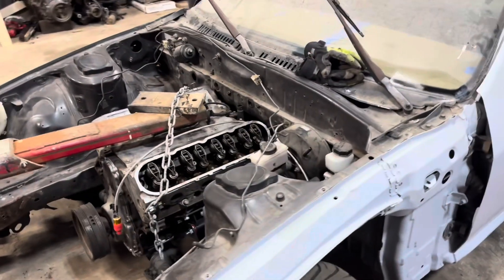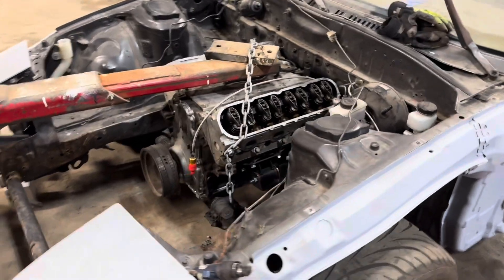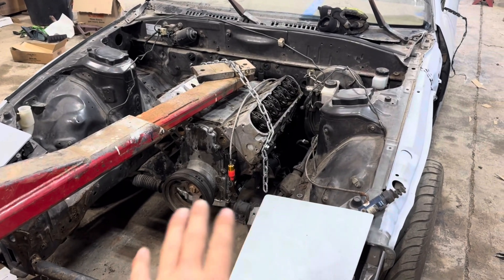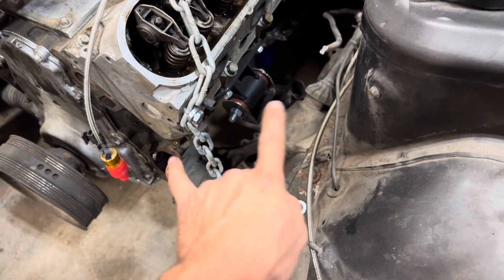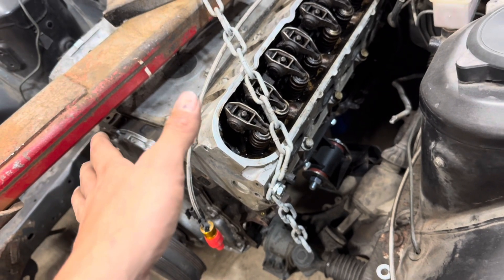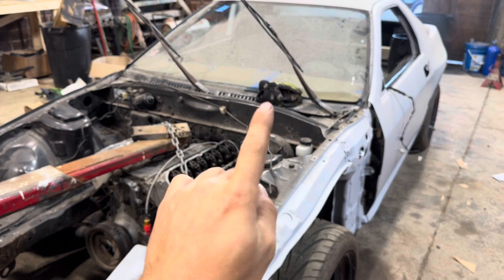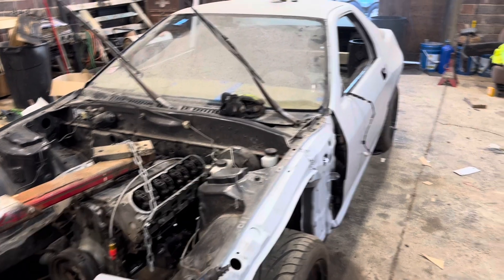I'm in a little bit of a hurry to beat the parts store closing, so I'm not going to film a whole lot of this motor coming out and getting separated. There's plenty of room — I cut out all the front of the car. I have the bottom bolt unbolted already, so I can pick up a little weight on the motor and unbolt this one. I'll use the motor itself to stop it from rolling, then I'll jack underneath the transmission and roll the car out of my way.